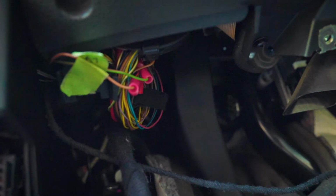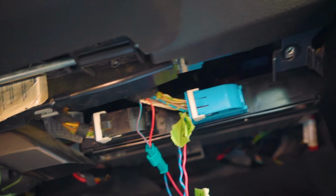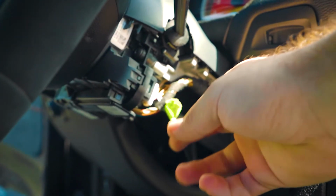We're gonna jump to the other side and we're gonna go over some more stuff. So now that we're on this side, you can see this is the cable that goes up here. You pretty much just tuck it underneath all these plastic trim pieces. This cover right here is gonna go up right here, and it'll hide all these cables. So we got A5 right here, A3 and A4, and it goes into this connector right here. Like I showed, you pull it apart, take this connector out, you pull it apart, and you repin them. The cable goes here underneath this plastic trim, underneath the ashtray, over and out, and underneath the center console.